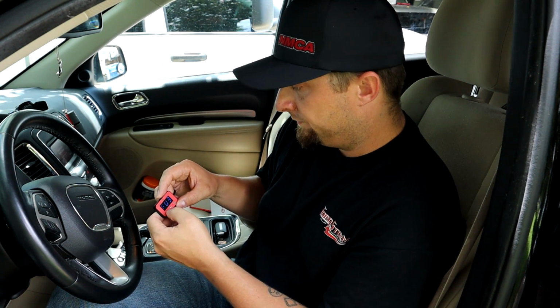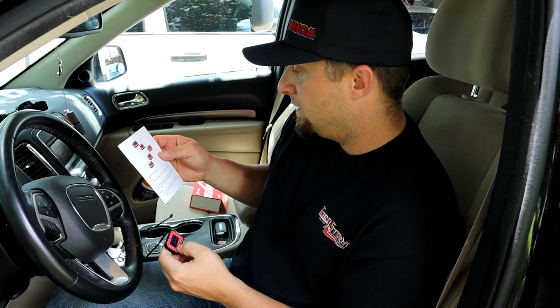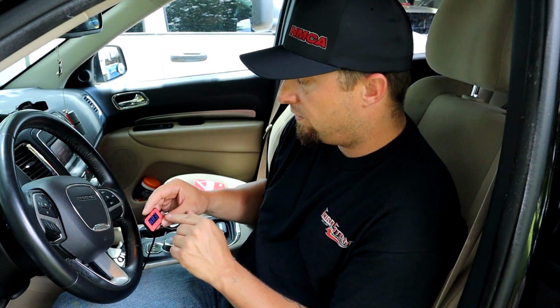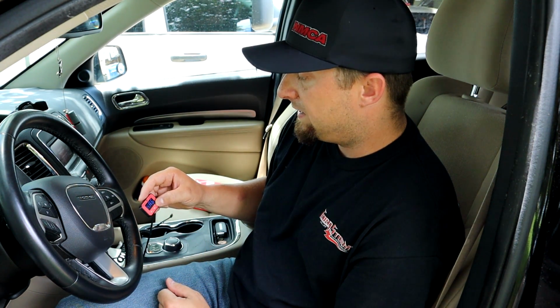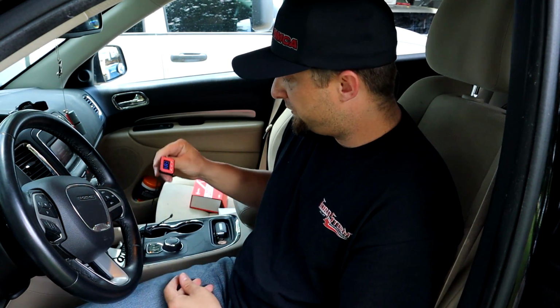So we're going to hit the M button and go down to HA for sport mode. So there's HA, and it's already set on 3, but if I wanted to turn that up, you would hit the up arrow, and that's level 4, 5, 6, 7, 8, 9. But we're going to leave it down there at 3, where they pretty much have everything set from the factory. So right now, we have the Durango programmed to sport mode level 3, which is a 1-to-1 pedal ratio. So the next step is, I'm just going to tuck this over here in the cup holder, and we're going to go for a test drive.